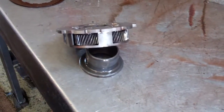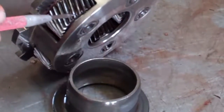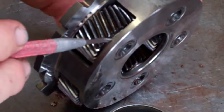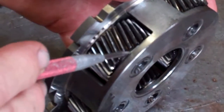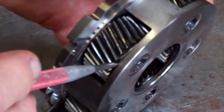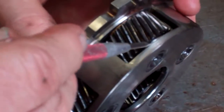I'm going to have Bob point it out. This rear planetary is no good. It's supposed to have a brass thrust washer on each end of that gear. Part of it's there, part of it's missing. The piece that's there is broken and the other ones are the same way — chunks of it are missing.